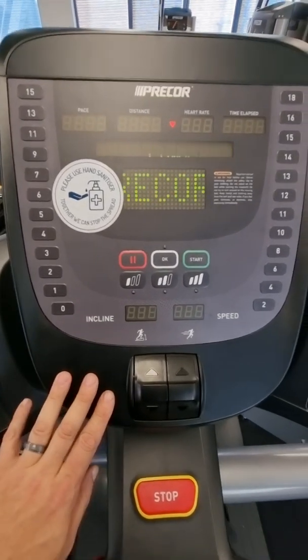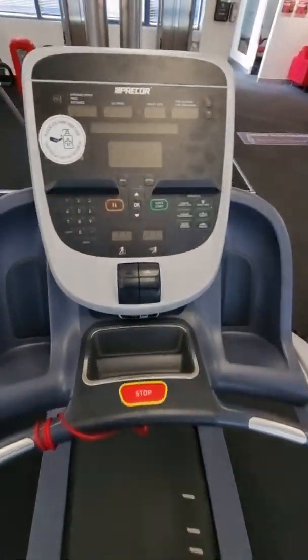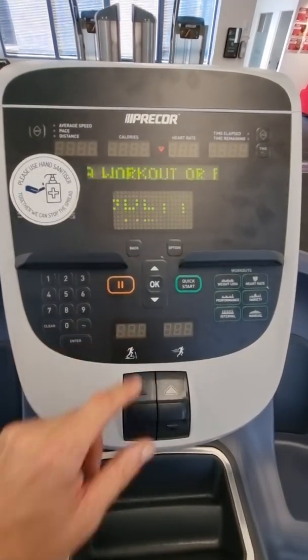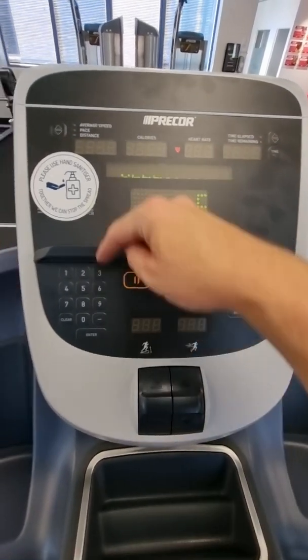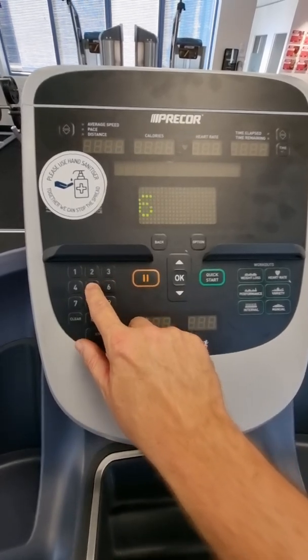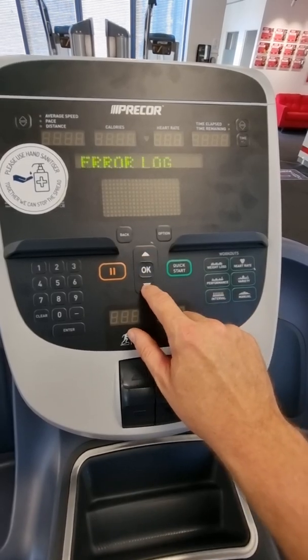This is the newer one being the black one. I've got another treadmill here which has the basic version, the P30 console. With this one it's pretty much the same except you've got your up and down arrows here, so you don't have the speeds up and down the side of the console. For basic settings you just do pause 6-5 and it will come up, and then you can scroll through to what you like.